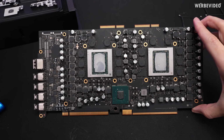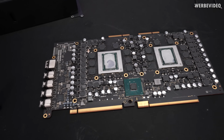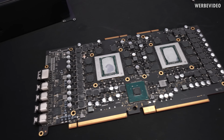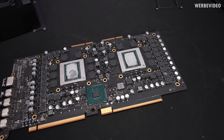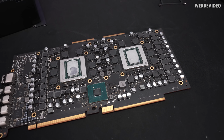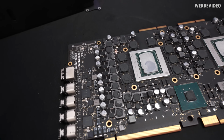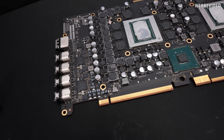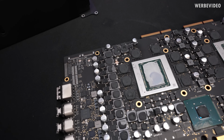And it's also quite cool that because it doesn't use any fans, it was so easy to disassemble. So there was no additional fan cable or anything I had to remove. But yeah, just looking at the layout and the components and everything, what a nice card. And what you might notice is that if you look at this thermal putty again, you can see that it's probably only covering maybe 50 to 75% of most of the components.